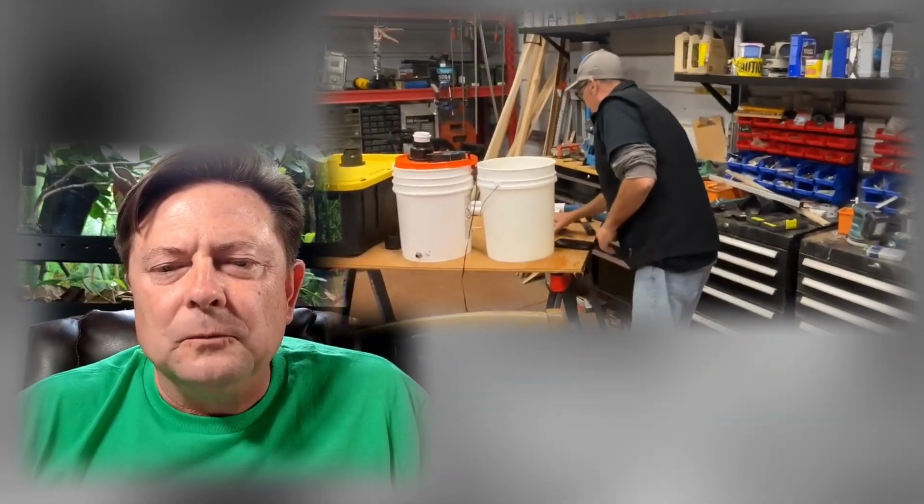When you brought up that transducer, there was a housing it was sitting in. What is that? It's called a float, and basically it is a float. It keeps the transducer floating at just the right level above the water to produce the fog. Once it goes too deep, you'll no longer get any fog. It literally keeps it an inch or so below the water level, and that's what allows the fog to be produced. If the transducer gets too deep, it'll dissipate before it gets out of the water.